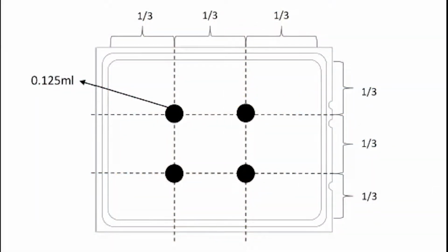Remove the thermal grease on the heatsink by using an alcohol cleaning pad. Apply new thermal grease to the top of the processor in a quadrilateral design. If you use a new heatsink, thermal grease will be pre-applied.